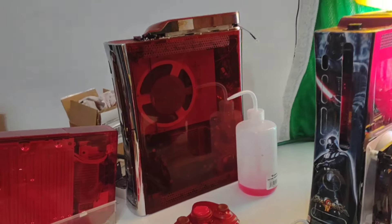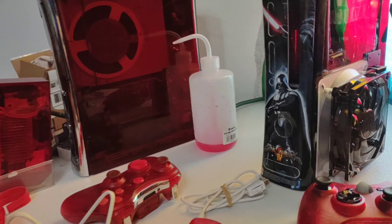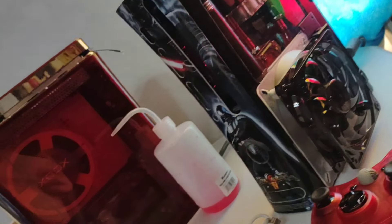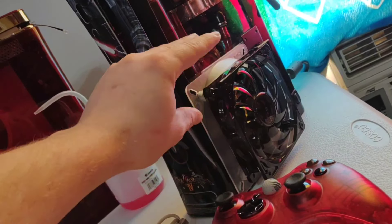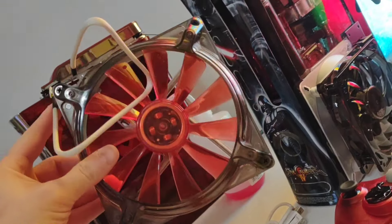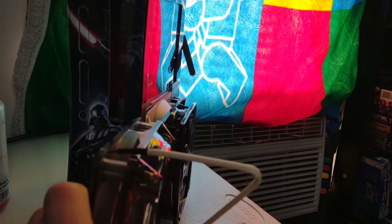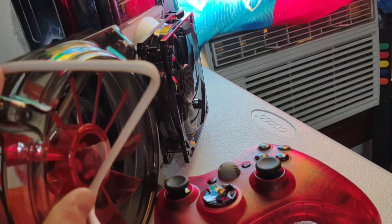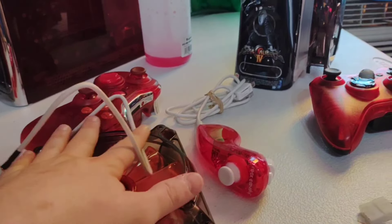What's going on everyone, today I got a lot of stuff to do now that it's the weekend. A couple things on Vader - I'm going to take this one apart hopefully for the last time. Same with Ruby Red - we need to block the blue LED in there, remove this 120mm fan and adapter, and we got this red scorpion fan in. It's basically the same thing except swapped - it's a 140mm fan that goes down to 120, so it's still the same 120 on the end, and that's going to fit our fan grill that matches our build.